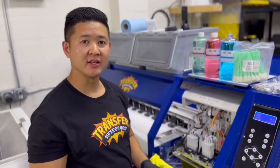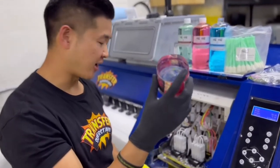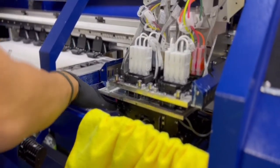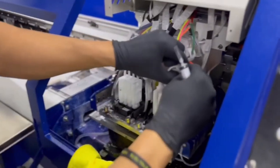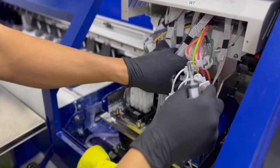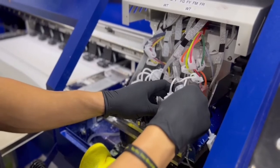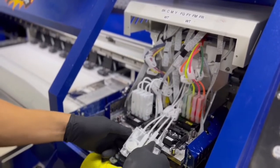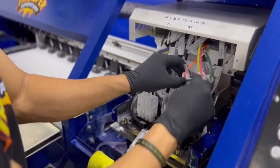Okay, so you've given it about 30 minutes and the printhead is still a bit clogged. What you want to do next is an ink head flush. What I use is an empty container that I cut so that it can fit underneath here — this is gonna be catching the excess solution that's gonna be dripping through. Next I'm gonna block off my channels so that I can access the orange that I'm gonna be cleaning. I'll block that off and then gently remove my dampers. The problem one is going to be the orange, so I'll also cap that off and pull that off.